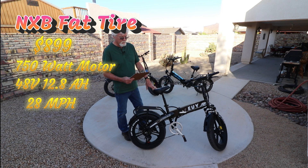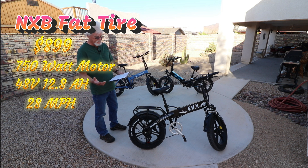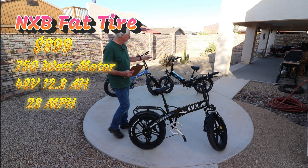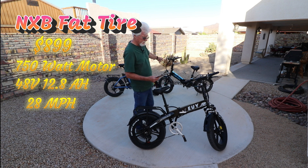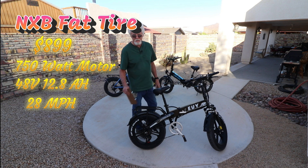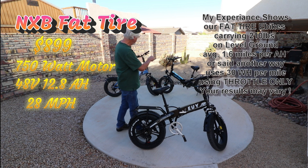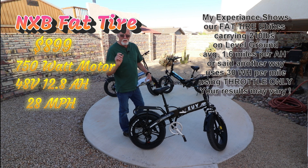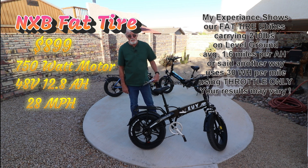The miles I got was 20 miles — 20 miles for the U-bike and 20 miles for the Haibike. On the Lectric, I have the long-range battery, and I got 22 miles. But the Lectric website says the long-range battery gets you 33% more distance, so extrapolating down to the 10-amp battery, I would have most likely got 16 miles. The math on that equals out to 1.6 miles per amp hour on all three bikes. So if it had a 10 amp-hour battery you'd get 16 miles, and a 20 amp-hour battery would get you 32 miles, riding it as hard as you can on throttle only.